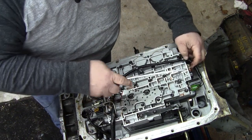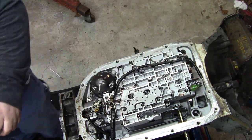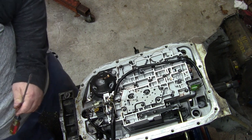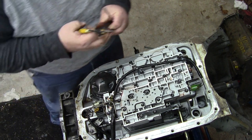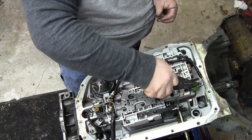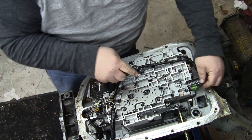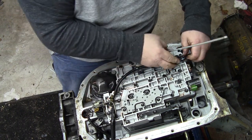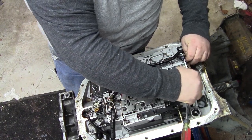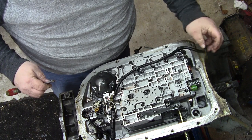Take your wire harness off next. That one's already broken — somebody zip-tied it on there. What I was saying, if you didn't catch it earlier: the pan gaskets are reusable. Zip tie off there. Clip out of there, clip out of there — don't try to pry them too far because they're going to be brittle a lot of times. Yep, see, just like that one broke. It is what it is.